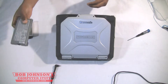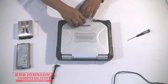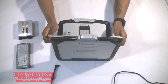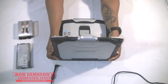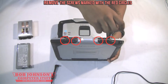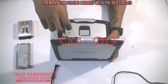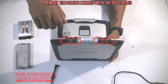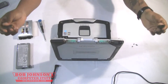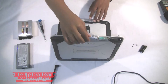What you're going to need is a Phillips head screwdriver to do this. Now that we have removed the battery and the hard drive from the Panasonic Toughbook CF-30, we are now going to remove the screws for the antenna covers. Once you have removed the screws for the antenna covers, you can remove the antenna covers themselves by lifting them out of place.